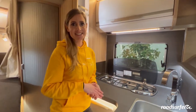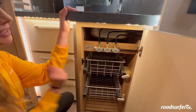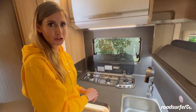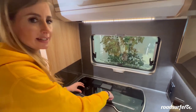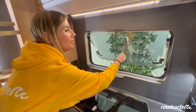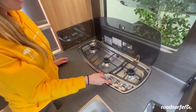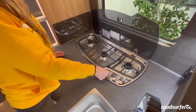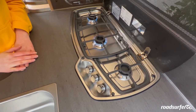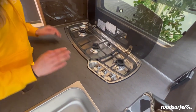In order to cook, you need gas. First open the large gas bottle at the back, and when it is open, find the switch with the cooking pot symbol and turn it upwards so the gas can flow to the cooker. It is important to open the window here before switching on the cooker. Then you can engage it at different stages. To turn on the cooker, press the button once, hold it down, and turn it to the left — the flame comes on. To switch it off again, simply turn the wheel to the right to the black dot.